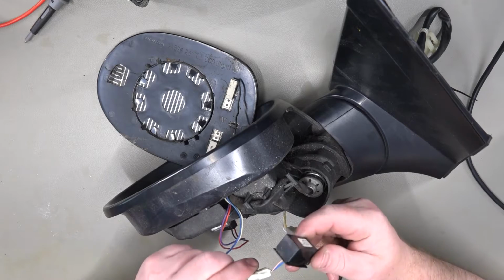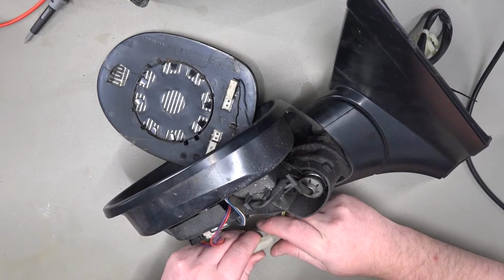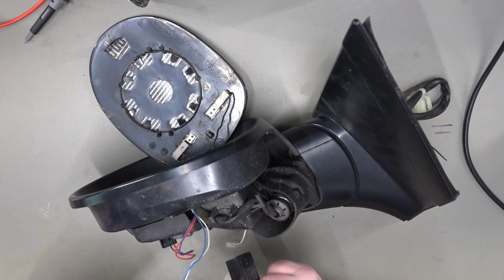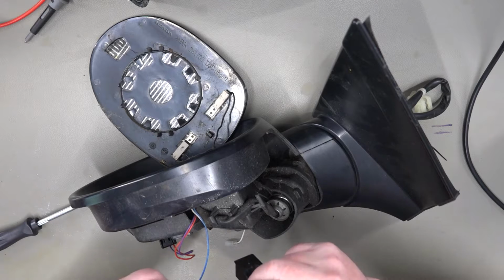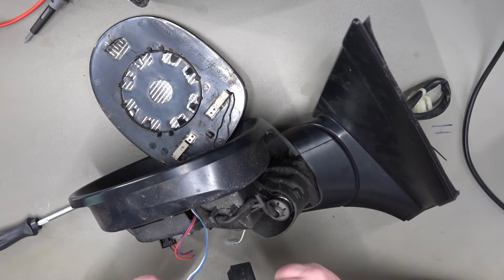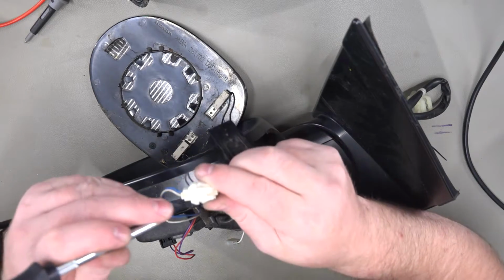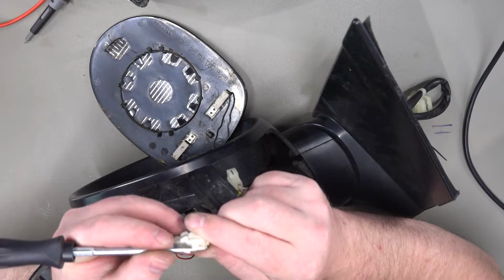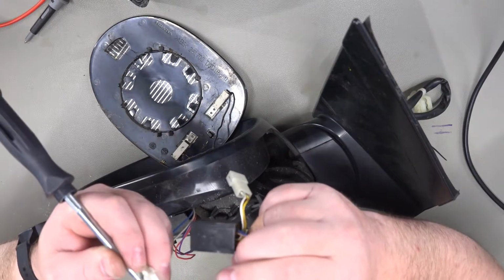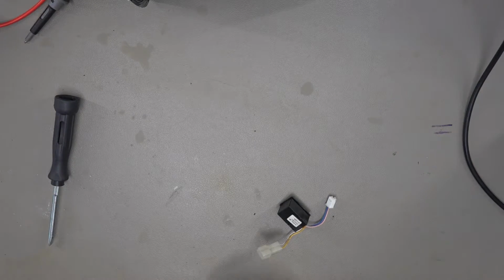At the back you will find this little unit here, and you can hopefully see that's our little thermal fuse. So let's disconnect the wiring adapters. Oh. Alright, this one's not as easy to actually get out as I thought it would be. It only seems to have one clip. Sorry, there's a little clip here. It should just push down and pull out, but, there we are, a little bit stiff. Okay, so we've released that unit. We can now put the rest of the assembly aside.